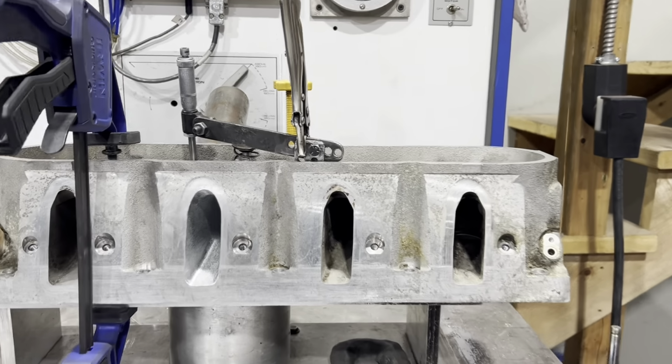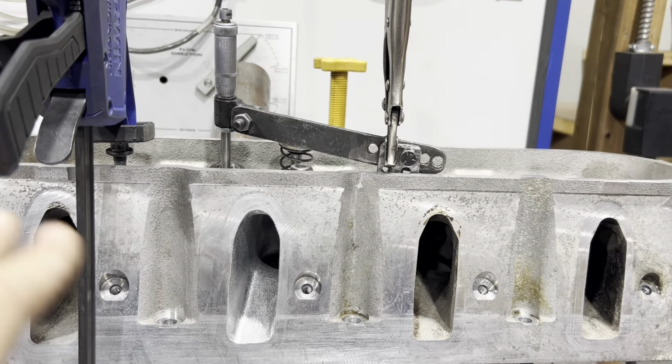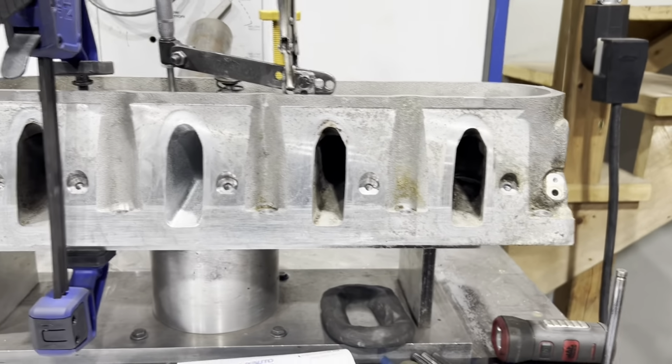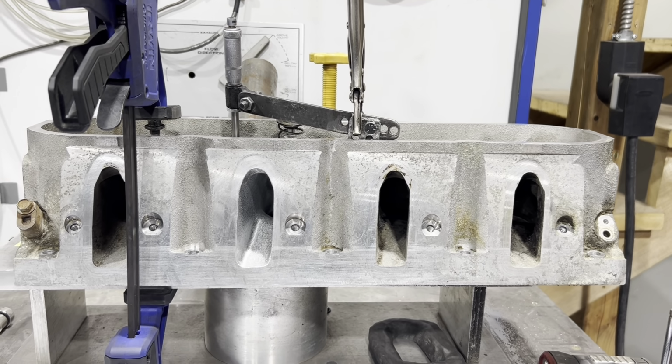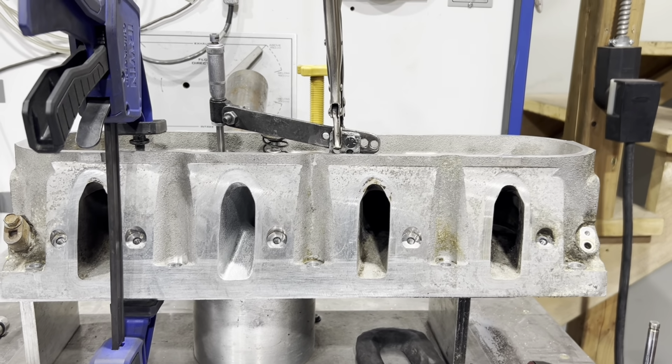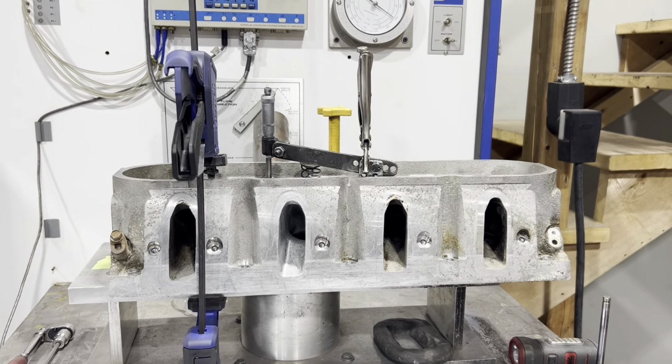Let's see what it does if I reface the valve, because the valve is not even refaced. It's stock the way it came out. I'll see the shape of the valve, and I'm going to try to do a little bit of a back cut and see how that affects it, if any, or if we go backwards or whatever. Hold on, and let's see the results.